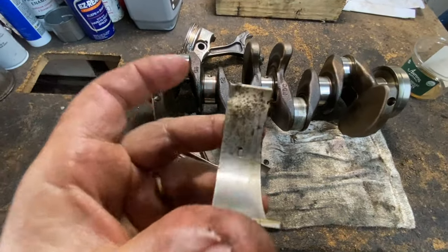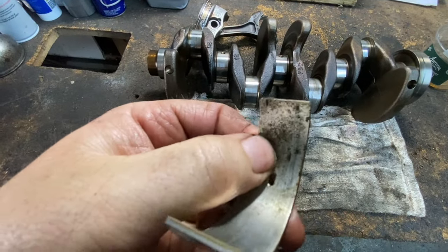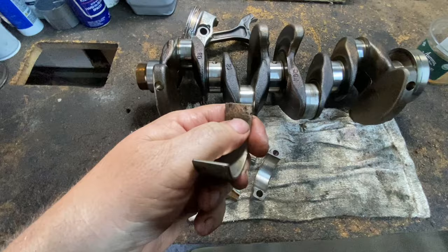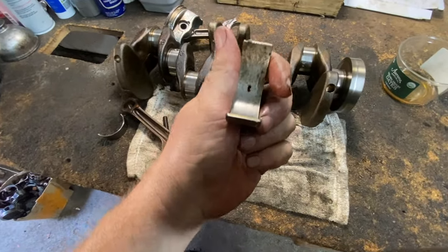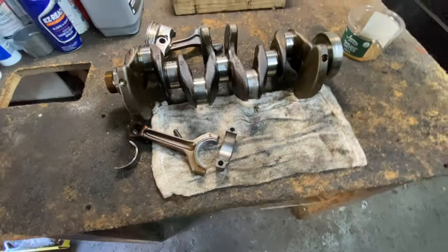Here's another bearing that was pitted. You see this? You can imagine this is like sandpaper. All right? This is because of not changing your air filter or the oil filter. All right? Everything gets sucked in, burned, and believe it or not, it all can end up on the bottom end of the engine. Okay, so now why is it...